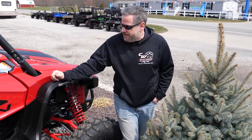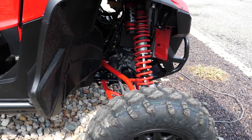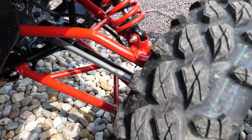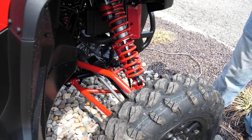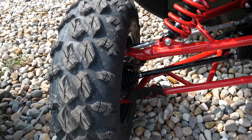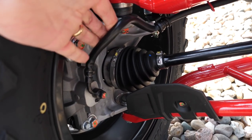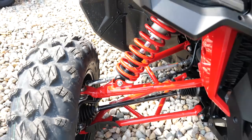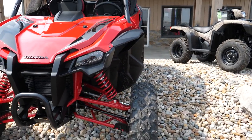So Doug's gonna give you guys a walk around, we're gonna talk about some of the stuff that we know, and then we're gonna get to take a drive in it. Excuse the traffic noise, it's how it is. Some of the first things we noticed: the tie rods are nice and beefy. They look a little beefier even than the Razor tie rods, which is good. The A-arms, upper and lower on the front, are pretty good — nice thick metal. I don't think you're gonna have any major problems; they even have built-in gussets. One shortcoming I do see is on the front, a brake line where the banjo bolt actually sits proud of the wheel a little bit, and it's rubber brake lines going directly down into the caliper, so that could need to be addressed. It seems like it wants to catch on a tree branch or something, so that's something that needs looking out for.